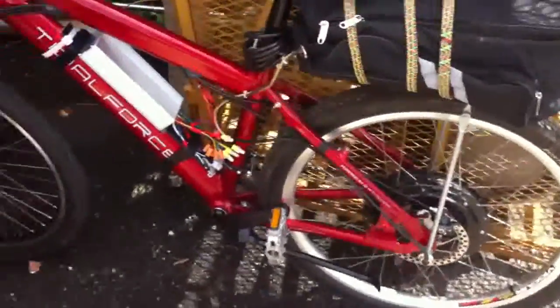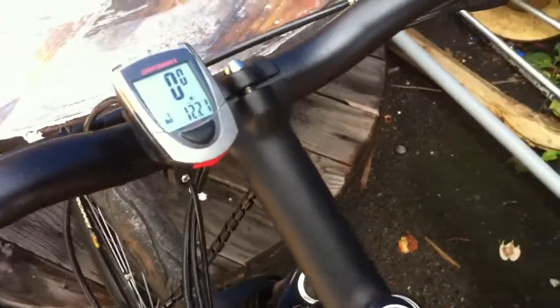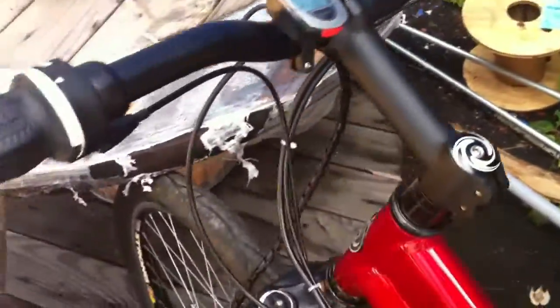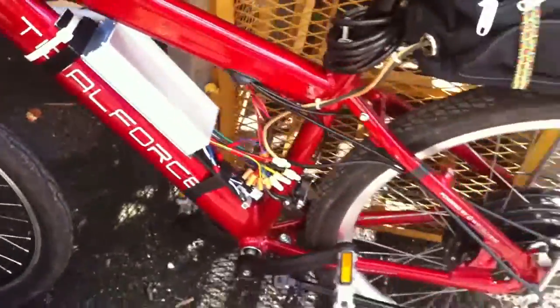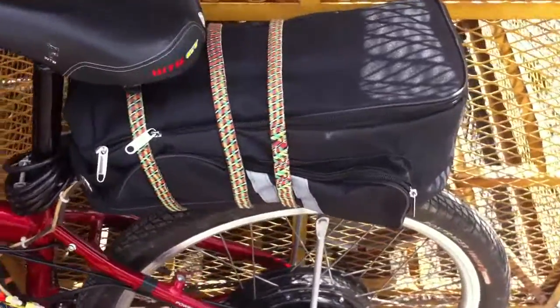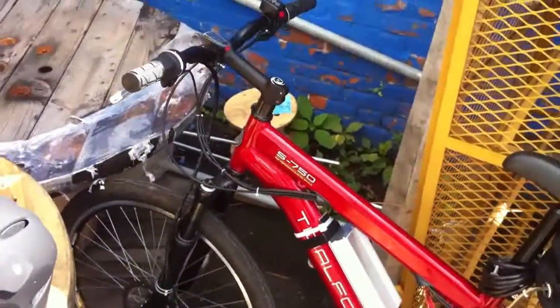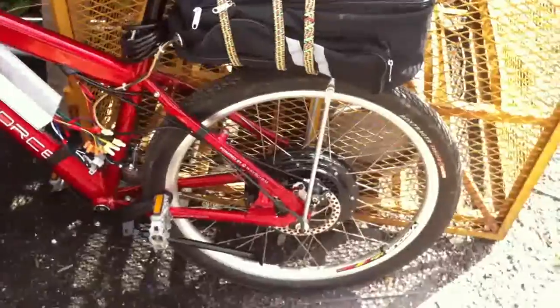I just had to take the bike into the city. Every pack I got on the bike and 12.2 miles to get here, and I need to go another 12.2 miles to get back home. The packs were at 62.5 volts when I plugged them in and they're still at 60.8 right now. I was very easy on the throttle the whole way out, so hopefully I can make it back home.